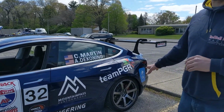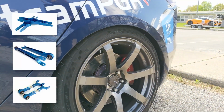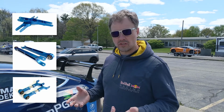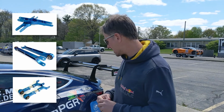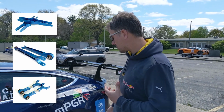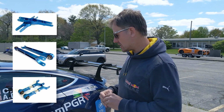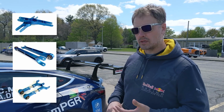The rear setup replaces a number of arms in the rear. It's got a multi-link rear suspension where the stock arms honestly are a little bit flimsy. They bend and break pretty easily, not necessarily on the track, but with any kind of contact with a curb, but those are going to be the fuses, basically. So the newer arms are stout. They're built out of a forged aluminum setup. They've got sealed joints so that you don't have to worry about tearing up the heim joints over time. So it's really good. And then again, you get that toe adjustability and that camber adjustability in the rear.